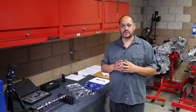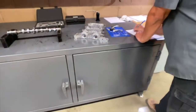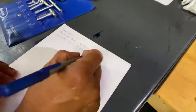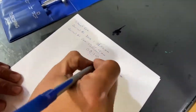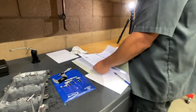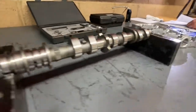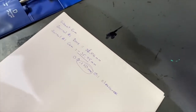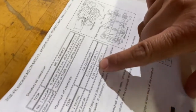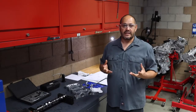Now that we have our measurements, we're going to do a little bit of math. My exhaust cam journal number one bore was 36.06 millimeters, and journal number one on the cam was 35.95 millimeters. Toyota has us measuring the oil clearance, so when we subtract our cam from our bore, our oil clearance is 0.11 millimeters. Comparing to the specification, the book says the maximum oil clearance is 0.10 millimeters. I'm over by 0.01 millimeters, which means the component would need to be replaced.